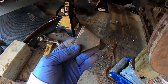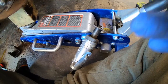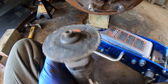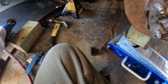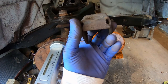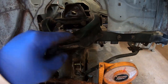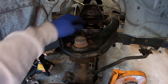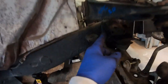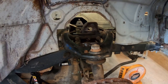I also cut off one of the two bump stops and I'm going to cut the other one off. The problem is it's hard to get the cut-off wheel in there. I cut the bump stop off with a two-inch wheel — haven't used this thing in years, it's very slow especially on this thick frame stuff. I cut off the front one and I plan to put it back on, just moved over a little bit. I need to move it because it hit the lower control arm, and also I need room in there for the coilover. I think I've got this working — now I've got to weld some plate and make this permanent, which is always scary.